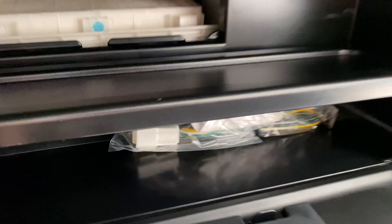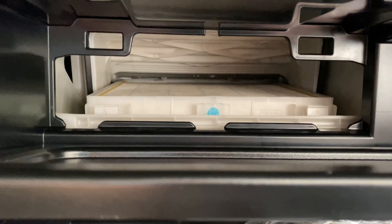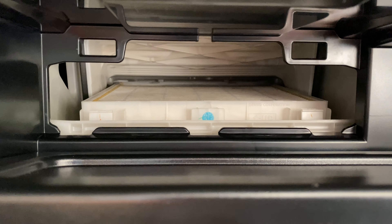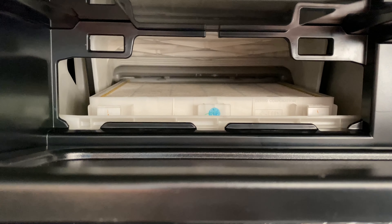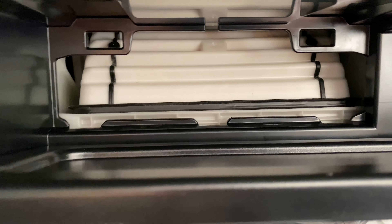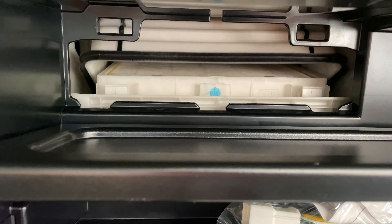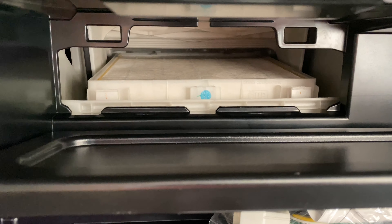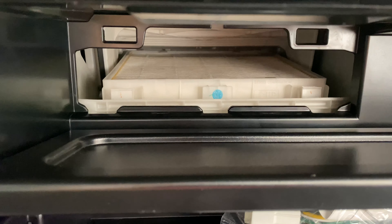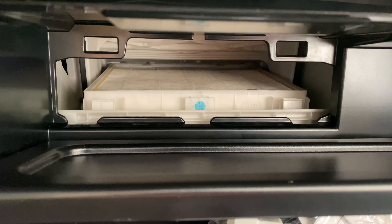As you can see it's open, but this door does come down — I'll show you that right now. That door comes down anytime you have it in outside air mode. When you change it back to recirculate, it opens up. That's key — you want it open. A lot of dealers will break this by forcing it up.